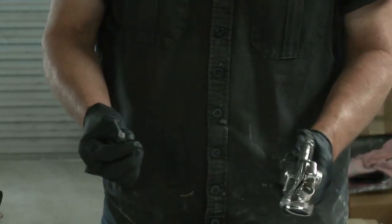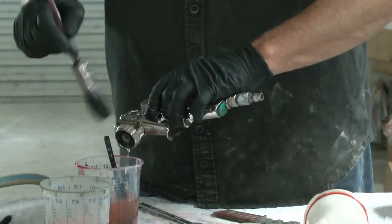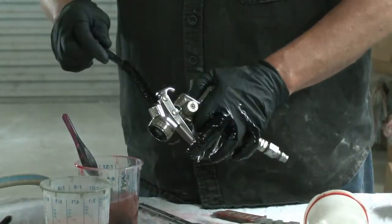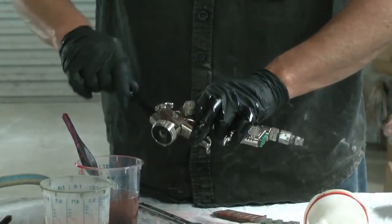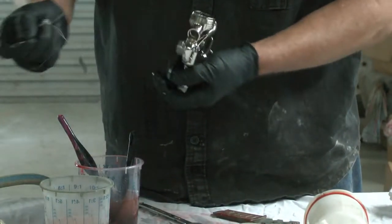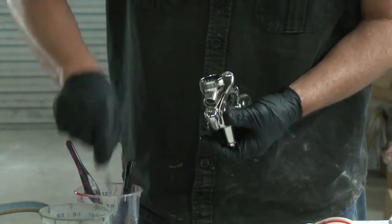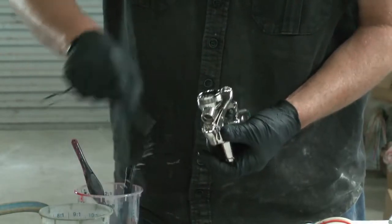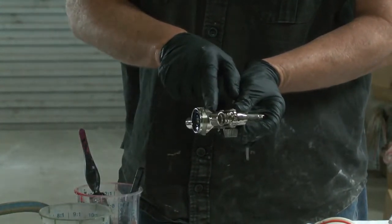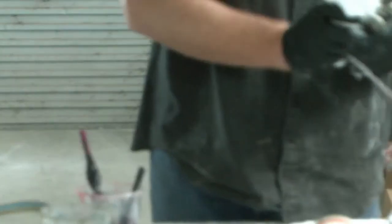Mixture adjustment and the needle — exactly the same as we did with the suction feed gun. Brush the outside of the body to get any excess paint material off it, wash that off, and then run a brush through the paint passage. Same as before, you need to run a brush into the needle cavity. Now for a long time I was getting little flecks of paint coming through in my clear coats. It's a bit embarrassing when you paint a white car after painting a black car and do a clear over solid and there's little black spikes in it. I worked it out — it was the paint just sitting inside that little bit of the casting in there, and it was coming out walking out with the needle.